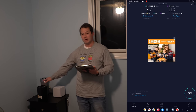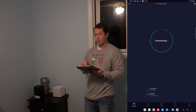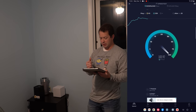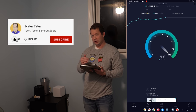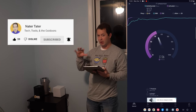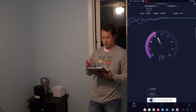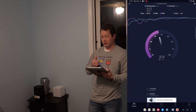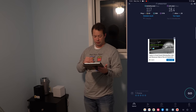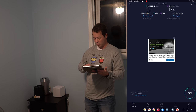Switching over to the T-Mobile Arcadian KVD21. It's showing I'm on the T-Mobile network, using a different server. I'm getting around 100 Mbps - probably on N71 band. Up here I'm right on the cusp of getting N41 with just the stock unit; with my Waveform antennas I'd certainly lock onto it. Ping is way worse on T-Mobile compared to Verizon, and speeds are lower. Upload is fairly close to the 20 Mbps I got before. Let me check the T-Mobile app to confirm what bands I'm on.